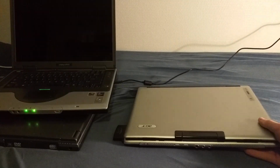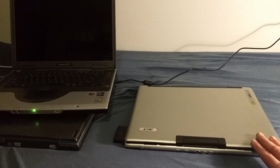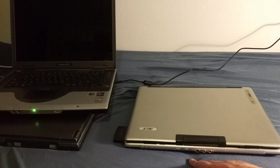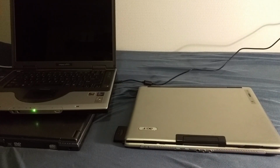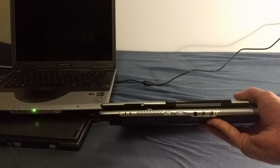And it's not perfect either. This laptop only really has 2 problems. One is not necessarily a hardware defect, but more of a restriction. So the real problem with this laptop is that your Wi-Fi button is busted, and it's busted in the off position. So internal Wi-Fi cards will no longer pick up a signal. Very annoying. I had to add a PC card adapter in order to get this thing on the Wi-Fi again. The other thing is that it will not run with anything faster than a Celeron M, because it has a 940GML chipset. But let's take a look at the exterior of the laptop.